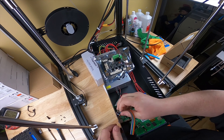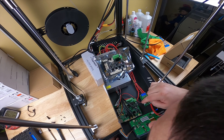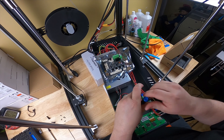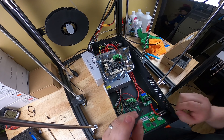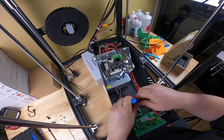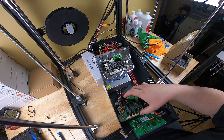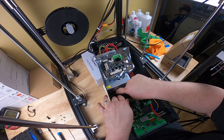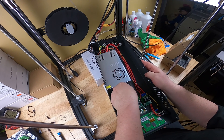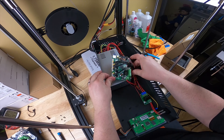What we're gonna do is one wire at a time. Let's move the monitor wire out of the way - we know where that goes. You've got one, two, three, four screws and they all look like they're still two millimeter - they are. We're gonna take the board out, move it to the side, and switch one wire at a time. You can move this board right out of the way; these wires just tuck underneath that power supply for the most part, so you can move them to the side.